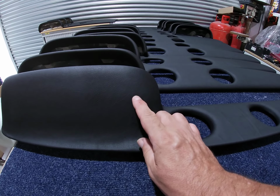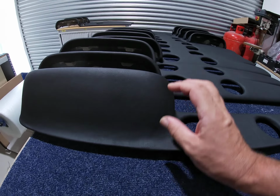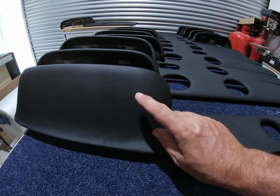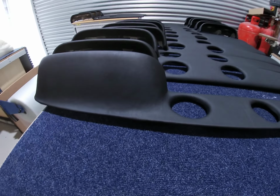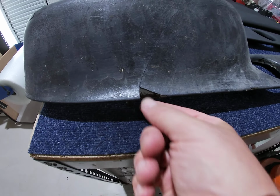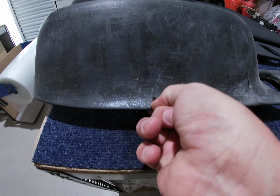And then we use a hot wax process to seal it, because the hot wax will not attack the injection mold foam. If you put body filler inside this, which a lot of people do, they pack them out with body filler, and I'll just show you what I mean. Like for instance, this here, you couldn't just put body filler on that. You have to take all this out, because all this has just gone, it's disintegrated.